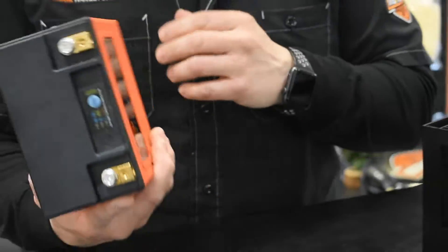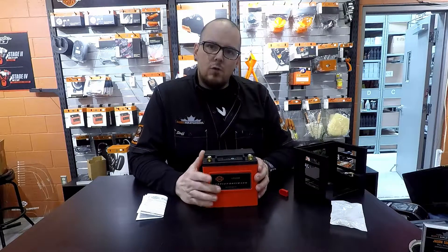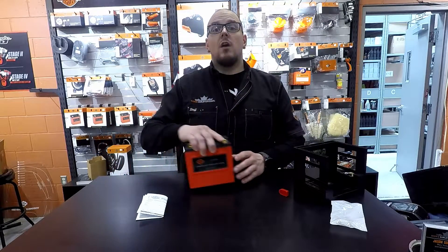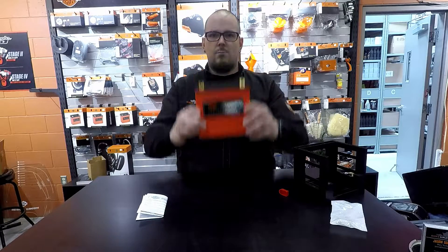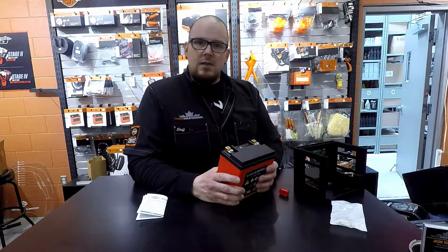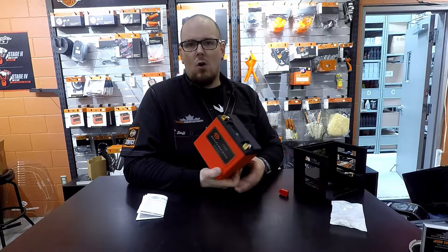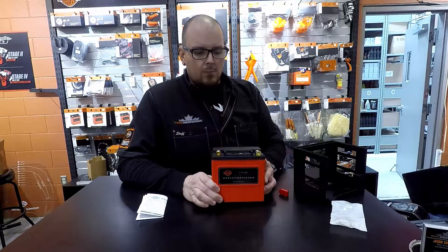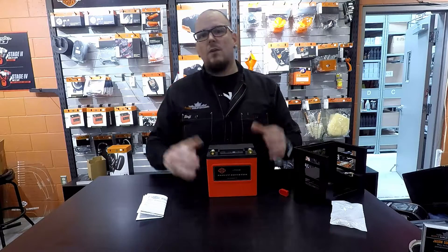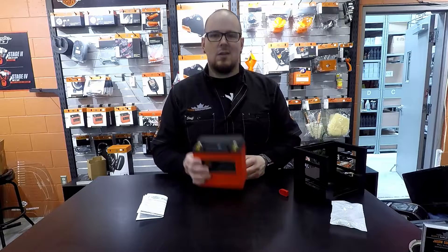The Life lithium-ion is a great product. Basically, give the battery one full charge right before winter, completely disconnect it from your bike, put it on a shelf, and come springtime you don't even have to charge it — just fire it back in and start your motorcycle. We always promote tending the battery since newer motorcycles with security systems have a constant draw, but if you can't plug in a tender, just unplug, charge fully, store it, and reinstall in spring.